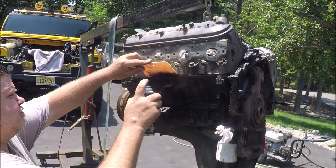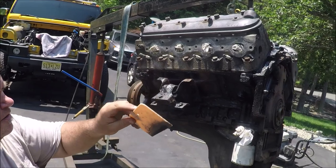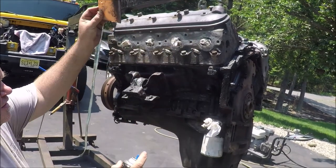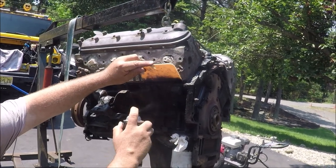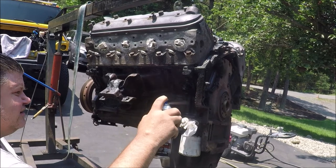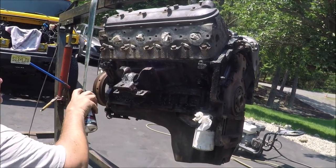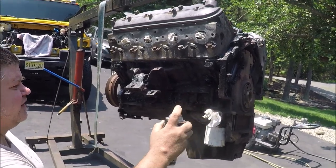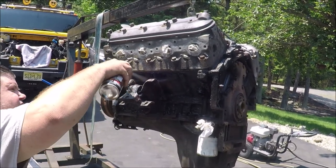It's pre-enjoyed. Yes, and a little tech tip, if you want to do a quick spray job on a motor, a Bondo card works really good to put right at the surface here, and look, nothing on your aluminum heads. Or you could tape. Yeah, tape don't stick for shit sometimes. I'm wondering what this is going to look like once we actually drop it into place, like how much paint falls off. We're probably not going to see anything, because you can't see it. It's like a GM trash can cover over the motor, and GM does like their plastic.